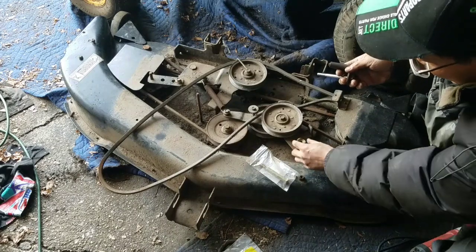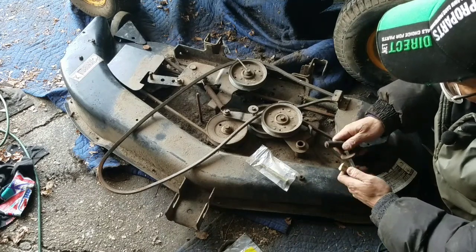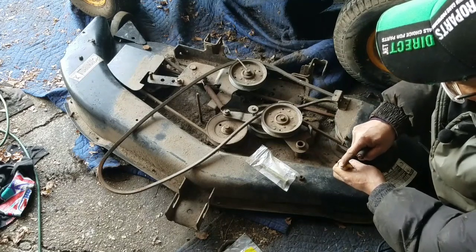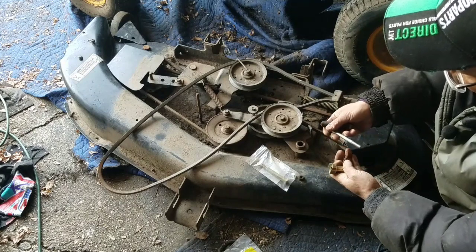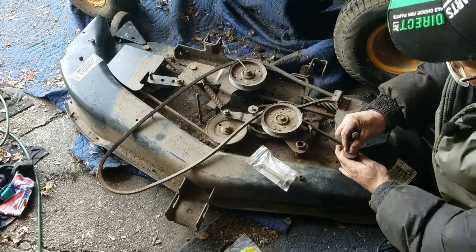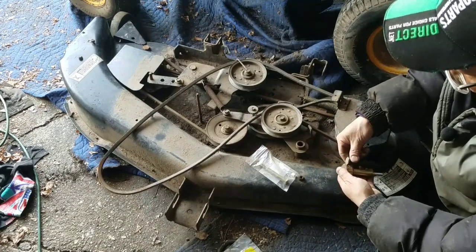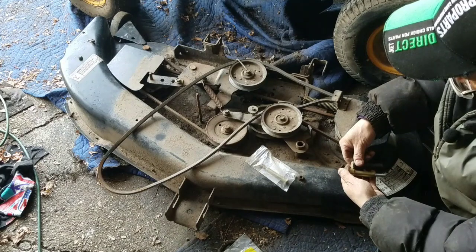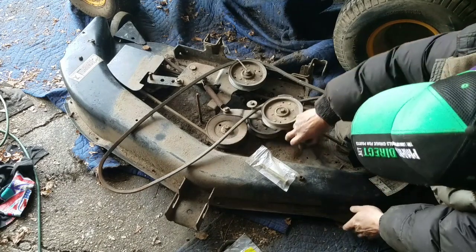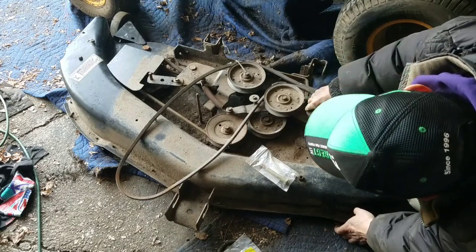Exactly, look at that. But this is kind of contoured over here so that if you have a bolt in there, let's say you have the bolt in here, you're not going to be able to turn it because of the contour. It's getting in the way of the nut. So I think this stud is long enough that I could actually accommodate a washer here, so in that way I can turn it, you know what I mean? This is the same shaft diameter as this one, maybe not as long, but it'll allow enough to get through to the bottom and maybe tighten it.